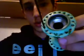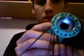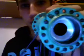Let's do it in this view. Alright, so here's what you want to do. Just start with the top flange, dropping the spokes in every other hole. I'm just going to do this facing me. It's not that hard. Shouldn't be hard to understand. I'll show you after I'm done, the whole thing. Alright, so that's what it should look like. Just like that. 9 spokes.